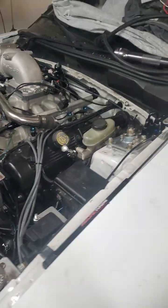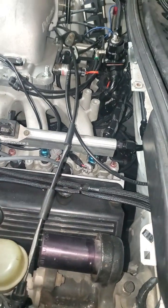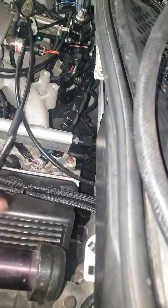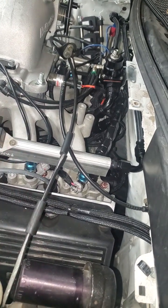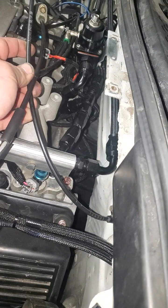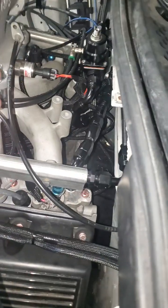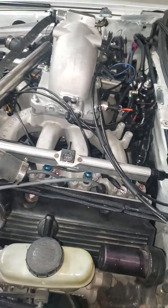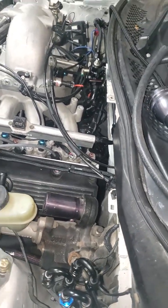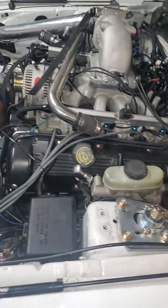I do gotta change the throttle cable. This is actually a '98 Cobra throttle cable — somebody else's that I've got to give back — but it actually looks like it's long enough to use, so I may not have to get a Motion Works throttle cable. The stock GT one is just way too short, it's way back here, so there's no way it would mount up. It looks like the Cobra one would reach, so I'm gonna do some searching on eBay for a '98 Cobra throttle cable. If anybody has any ideas what they used, throw them in the comments.